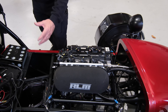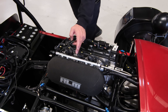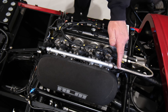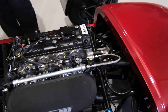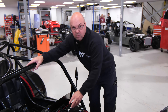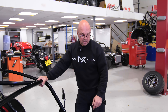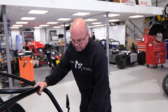That's an option on the cup cars and any of the Hayabusa engine adaptations. There are a few other changes - it's got different injectors, and the fuel rail they manufacture here is a really nice bit of kit. We've also got a fuel pressure switch that goes in here, so if we do drop in fuel pressure it will kill the ECU and prevent any engine damage. This ECU is very clever - it looks after the engine: oil pressures, water temperatures, all the alarm systems. Any problems, it's your little guardian angel to look after your engine in the event of a failure.